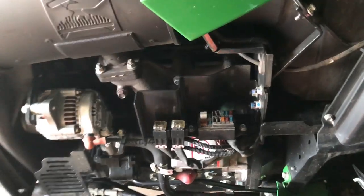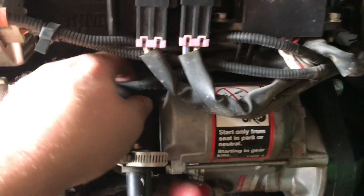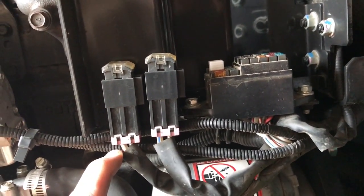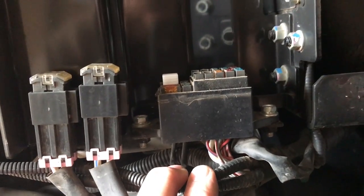And then I think these are just empty sockets. Yeah, there's nothing in them, no plug thingies. So it's not going to work too well there. I'm going to have to do like an inline fuse, I guess. Which will work, but somewhere in and around here I'm going to find power. They're done up very well, too. One of these circuits might be for starting, glowing stuff, although it doesn't have glow plugs apparently on this. It does show a symbol on there, glow plugs, but I don't know. So I might have to find a good circuit here somewhere, or just run right up through to the battery maybe. Could do that too, I guess. I really want to do the light. I'm going to have to do some routing here, I guess, and find a good source, but we may just have to tee into something on the back. That would kind of work, I would think, and go from there.